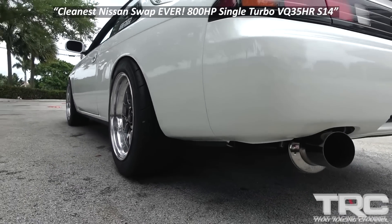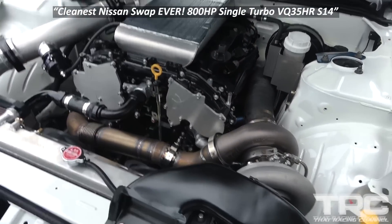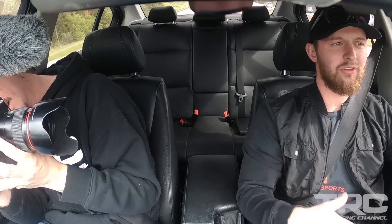I drove my buddy's DCT car and said I've got to have something with a DCT. There wasn't a lot of info on the HTG unit — I was by no means the first to do it. My buddy Andre in Florida put a DCT in his car and we worked through some bugs and issues together. There's been a lot of people I've talked with and helped, and they helped me — you only run into so many things by yourself. It's getting more popular. These transmissions are stout — bone stock gear set and it's holding up. The fact that it's so factory and I'm dealing with LS power — I'm not gentle on it. If the traction's there I give it boost as fast as I can. I have torque management on the shifts — I pull timing on shifts, boost by speed based off front wheel speed.